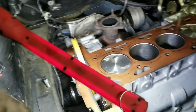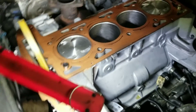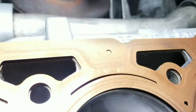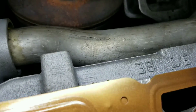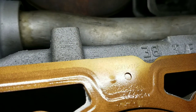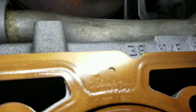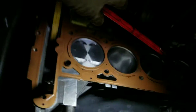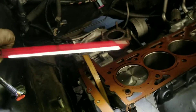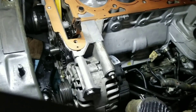Another thing — I have the new head gasket installed and I sprayed copper on it. It does have a side marking. See if I can show you — some little letters right on the edge, it says 'TOP.' So that's the sign — the top. Of course it's going to go with 'TOP' facing up. It says it only one way; there's no way to miss it.